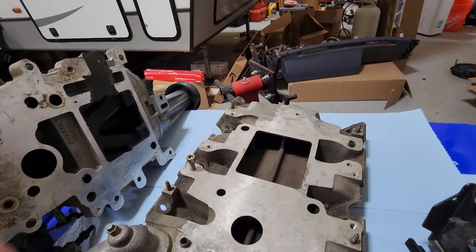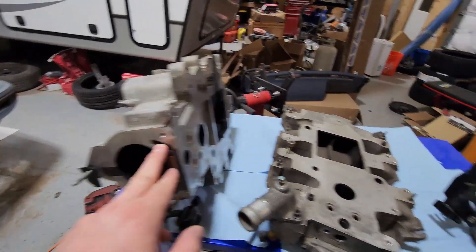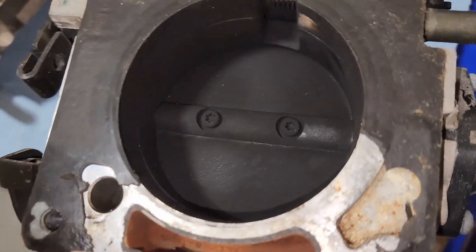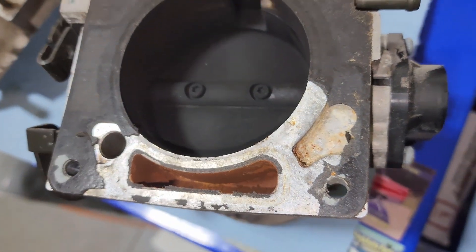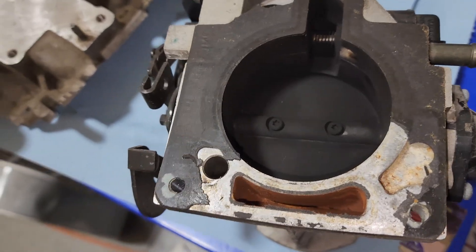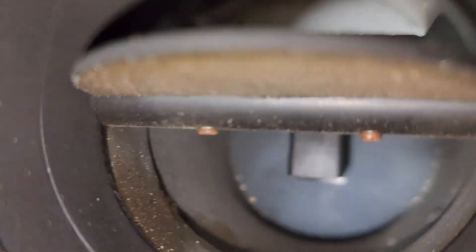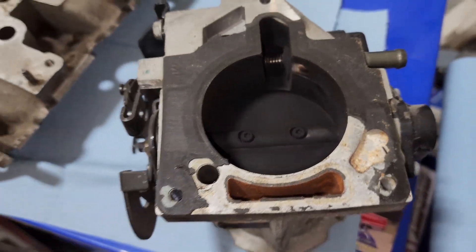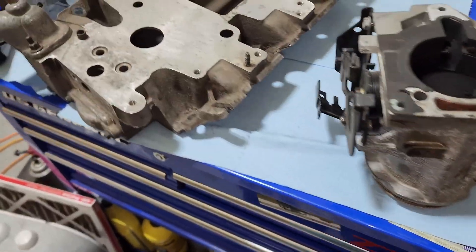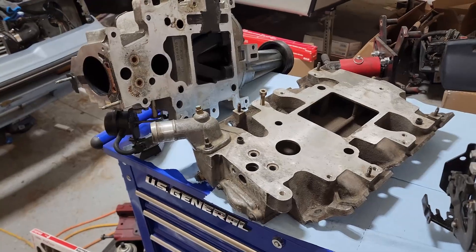Your other port goes into your throttle body — it goes into the supercharger, travels up and comes out over here, then goes into the throttle body through this port. This throttle body port goes past the butterfly, it's sealed past the butterfly and enters your intake system through this little port down there. Being on the other side of the throttle body blade it's always underneath constant ambient air pressure, at least close to it. You'll also notice that port is on this side of the mass airflow sensor, so any air that goes inside that port is being metered and measured by the MAF. When you have your fresh air inlet coming through here, going through your crankcase, back through your PCV valve and into the intake itself, it's metering that air — it knows how much is there and can compensate the fuel accordingly.